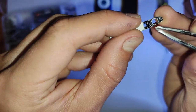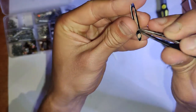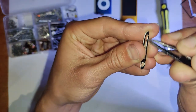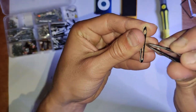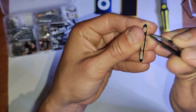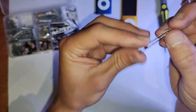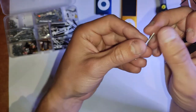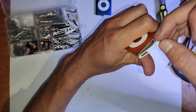And the same process for the top one. Making sure you clean off all the adhesive where the little lock switch goes. Again, you might be tempted to just put adhesive around the sides and not do the full coverage way that I do it, but you need adhesive on every millimeter of the plastic that you can, because there's not that much plastic that attaches, and if you don't, it'll just end up falling off anyway. So just copy how I do it.